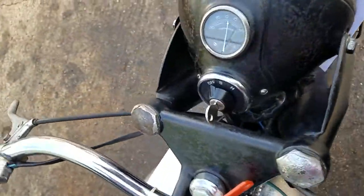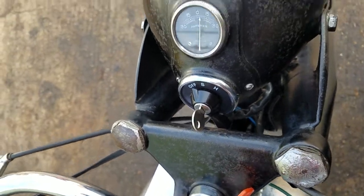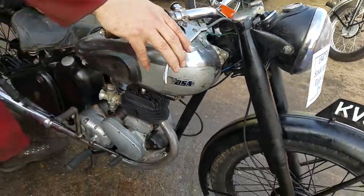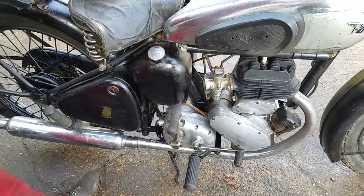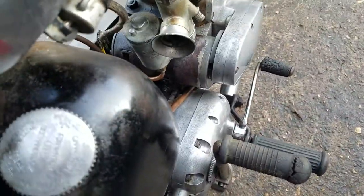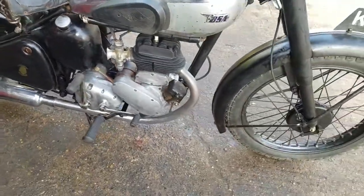Let's go over the electrics. We changed the switch. The ammeter doesn't work, but she charges — we've checked it. It all charges. It's got an electronic type regulator fitted, like an AO Services type one. It comes in with the extra long dynamo. Came in straight away, so we didn't have to do anything to that.